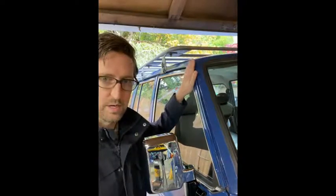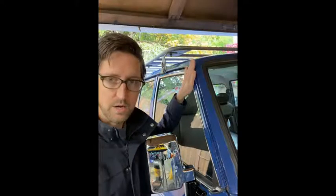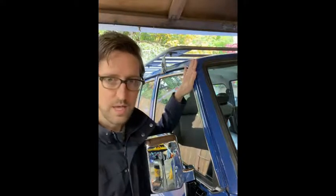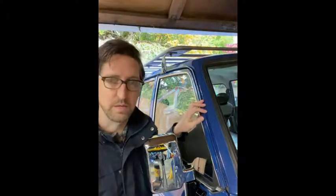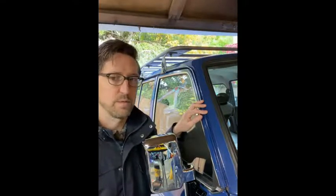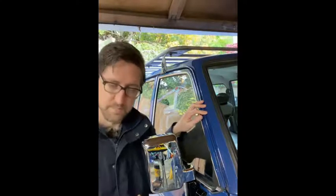Now, once your gutters are totally clean, you're happy with any rust treatment, and you got all the old seam sealer out, you're going to want to invest in some good 2K epoxy primer. Now, again, this is going back to, it's worth it to spend a little extra for the nicer materials, because you don't want to go in there again. You don't want to try to redo a factory job with worse materials than they used. You don't want to do this job again.